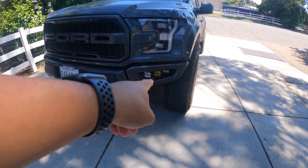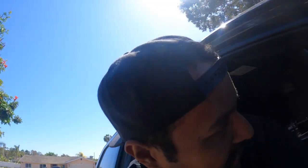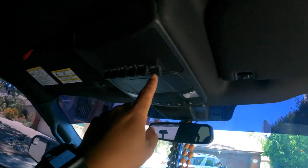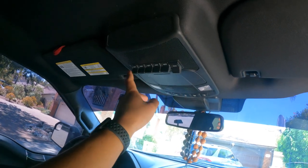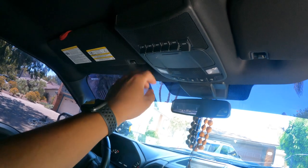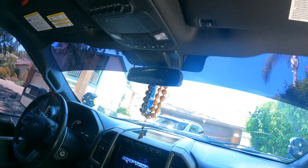I've got these two at the bottom here — I'm just gonna take that orange one off in the middle and it'll be good to go. The way they wired it up: Auxiliary 6 is for the daytime running amber, so that just stays on the whole time. Channels one through three are for the squadrons down below and the fog. Then the fourth switch is to turn the main lights on. I want to turn them on now but it's midday, so you're not really gonna see it. Later tonight I'll go to a parking lot and show you guys how really bright it is.